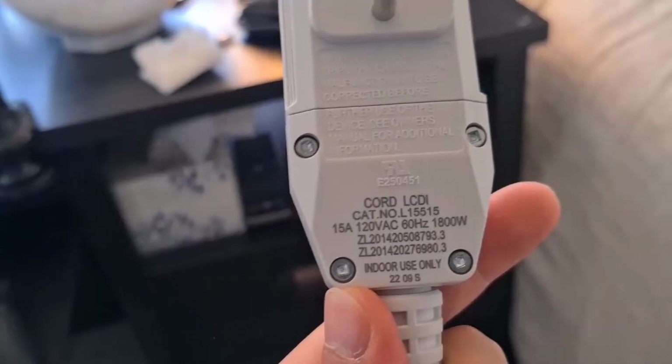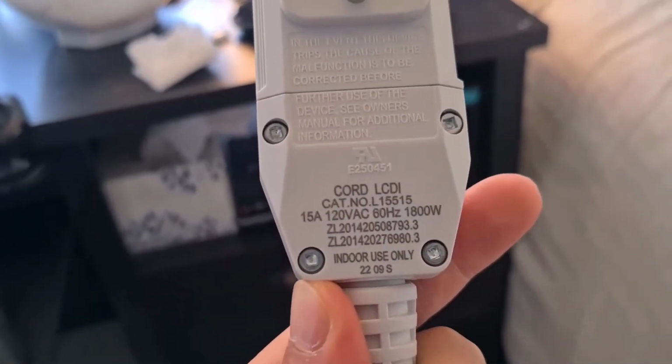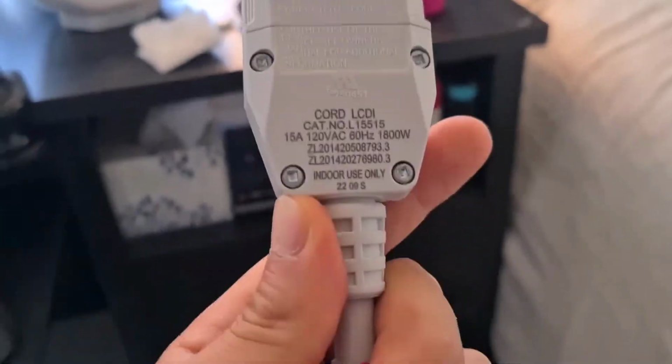What is the amperage draw from this unit in wattages? The peak amperage draw from this is 8.7 amps. And these are the specific measurements of the cord, the plug right here. Next is what type of refrigerant is used in this unit. This uses an R32 refrigerant, which is a newer model that can improve the efficiency by 10% compared to the older models.